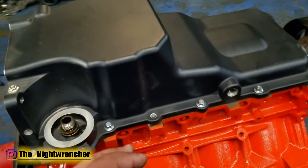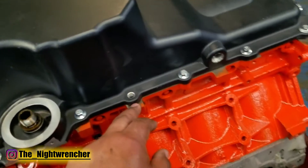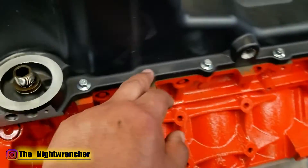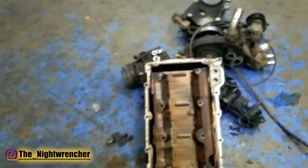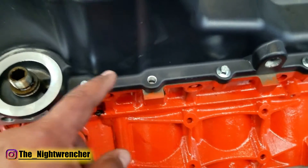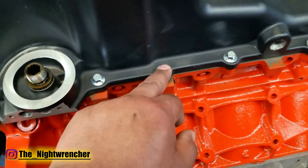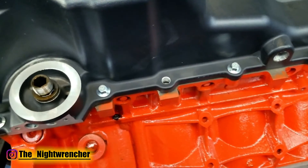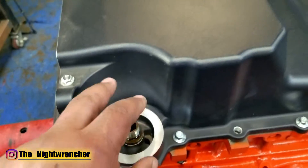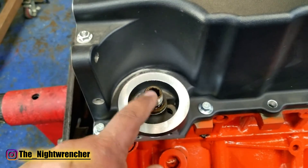One thing that did come up is that there is an extra bolt hole — I use the word 'extra' lightly — because apparently on the Gen 3 they don't actually have that bolt hole; it's blank right there. On the Gen 4 motors there is a bolt hole, and this pan over here is a Gen 4 and you can see the bolt hole is right there. The kit did come with the appropriate bolt in case you wanted to run it, but you'd have to drill and tap it. We also switched out the oil filter fitting adapter so we can use the standard truck oil filters, though the oil pan kit did come with the proper car oil filter adapter.